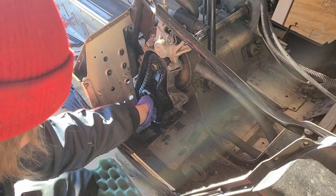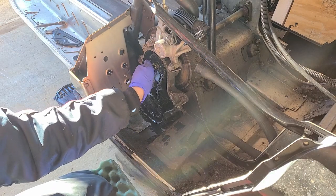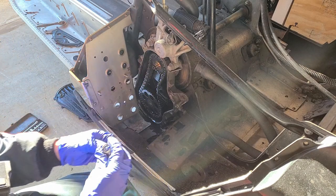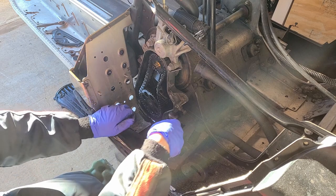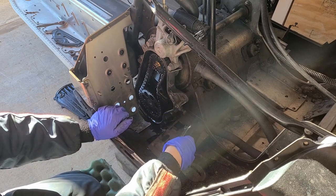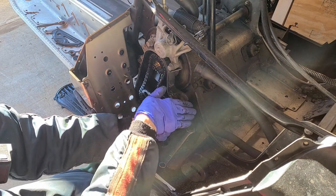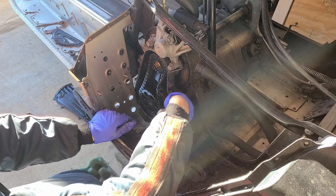Okay, so 14 mil on the bottom, big fat washer on there. They're both going to have that. I imagine this is a locking nut, it looks like a locking nut, also had a cotter pin, big fat washer. Okay, now let's see. The adjustment nut is a 14. The jam nut, I imagine, must be a 15. So we'll back that off. Back off the jam nut.